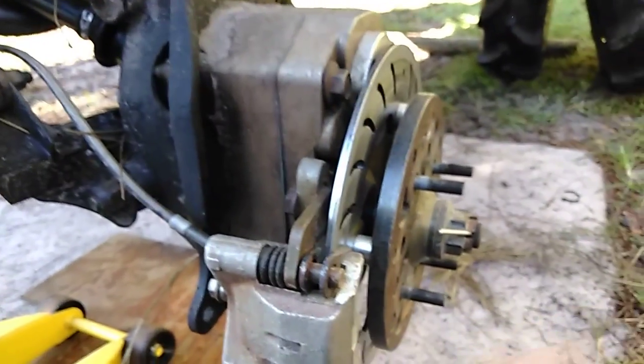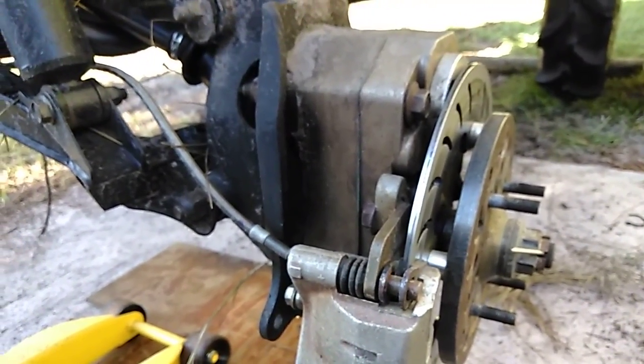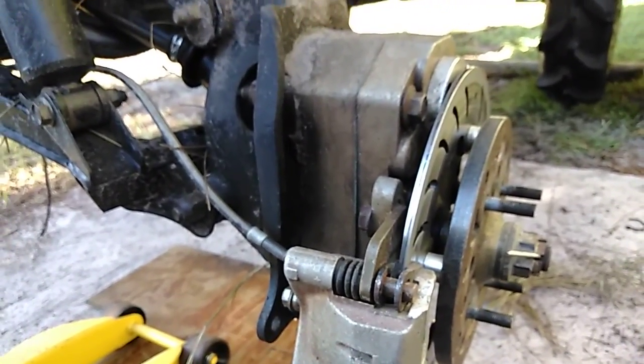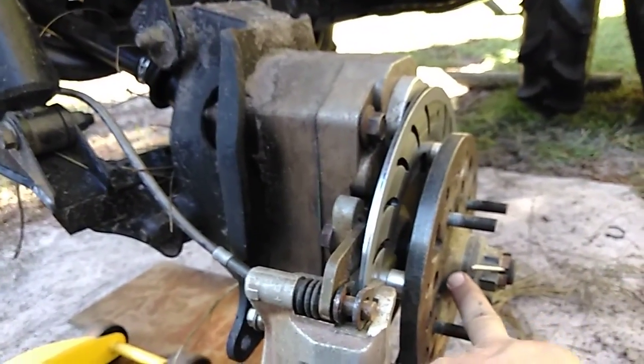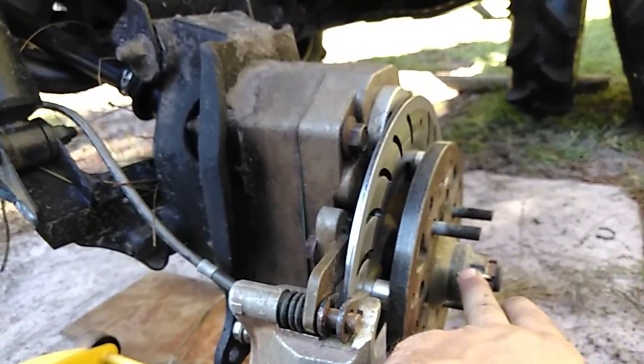Okay, well, I did that, and then they released a new spec about 6 months later. I have all the emails, and they said you need to torque these things to 200 something foot-pounds, like an insane amount of torque. So I'm like, all right, they released that for a reason. People are probably having issues with these splines. So I torqued all of them with a giant torque wrench to that exact torque spec.